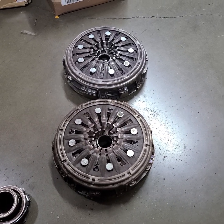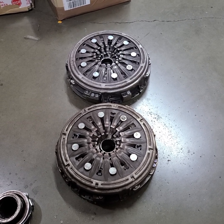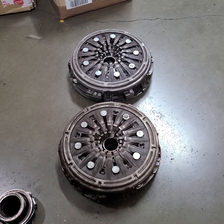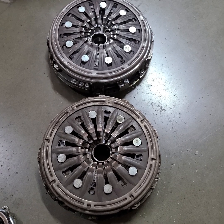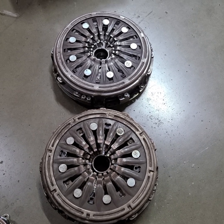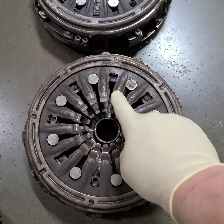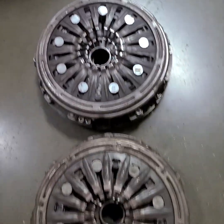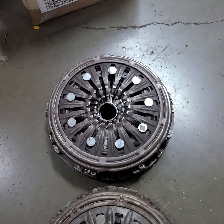For the Hyundai and Kia DCT clutch packs, we've had some debate on the functionality and holding capacity of these clutches. Right up front I'm going to show you a couple of clutches here. The first one on the bottom is a VT clutch, 2019-2020. The top clutch is out of a Kia Soul. See the fingers around here - a lot more of them. We've got eight buttons on the VT clutch, nine buttons on the Kia Soul clutch.